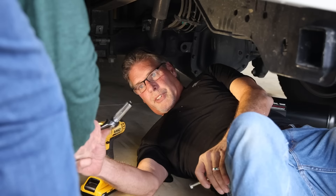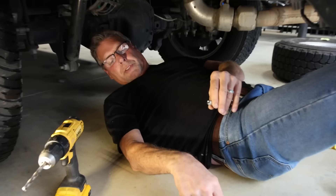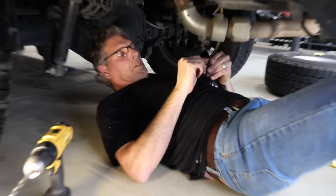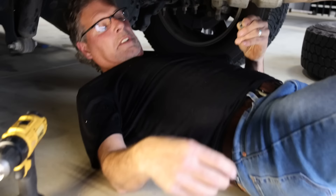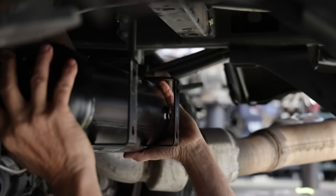The two bolts mounting the air tank are five-sixteenths bolts, half-inch socket, and they're three inches long. Our crossmember is two and a half inches — just enough to work with, because if they're too long you have to really work around getting your wrench in there. With the lock nuts on there it's very sturdy. The tank is mounted using the lower holes to make room for everything.